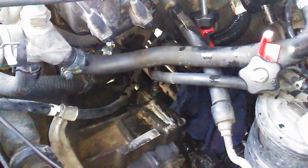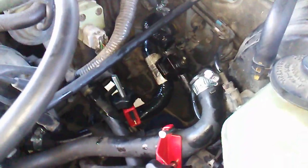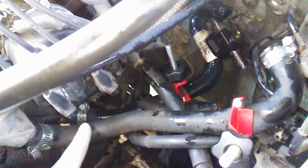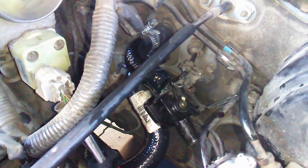I used every kind of plier I had and I couldn't get those clamps off. The upper hose comes in from this side, runs right here, goes into there, and comes in here. I believe this is a 5/8 hose so you might be able to bypass it with a normal hose, but you do need that 90-degree bend. Be careful with that hose — it's about 60 bucks and usually special order. The bottom one is usually in stock and has a bigger orifice opening on the engine block side.